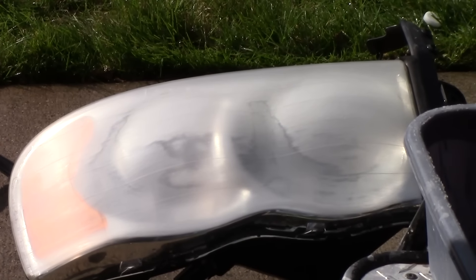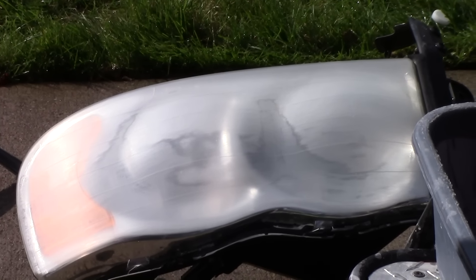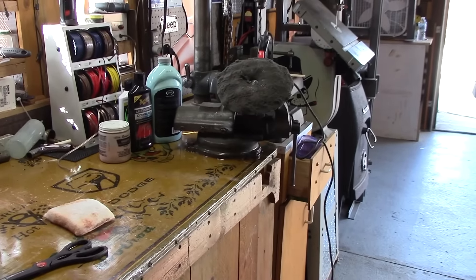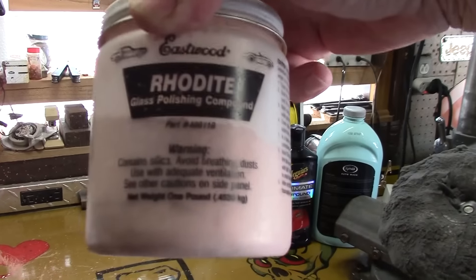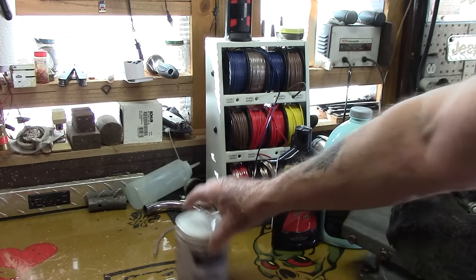Basically, that's what the lens looks like after water sanding. I'm going to take a coarser grit-type polish to break that down a little bit, seeing that I don't have any finer grit sandpaper. I'm going to cut that with a coarse grit and work my way down with a finer compound. I'll take you over to the workbench and show you how I do that. I mounted my sander polisher right into the vise, so I only have myself — I don't have three hands.